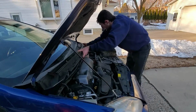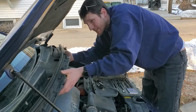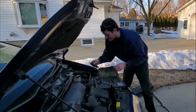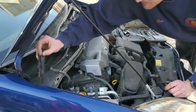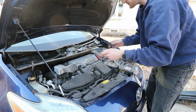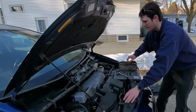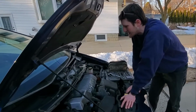So that's popped off the front there. Well, looks like we gotta clear the power steering there. Okay, and those pop off. Now you have these plastic side pieces. They have a tendency to kind of fall off because they're just held in by the pinch. So you're gonna grab them, make sure you don't lose them. And when you put the thing back in, make sure you put these plastic side pieces back. You might need a buddy to help hold them in while you put that plastic back in there. So you got the plastic out. Now we have this whole assembly right here to get off.